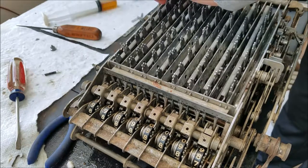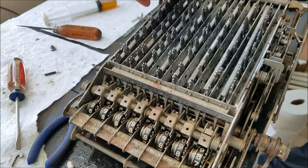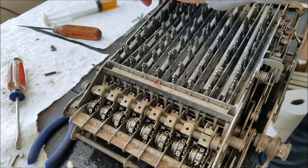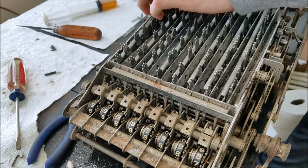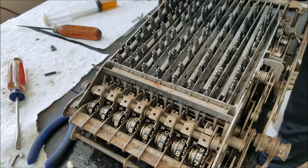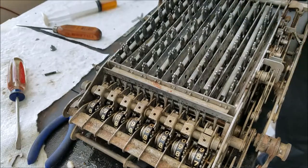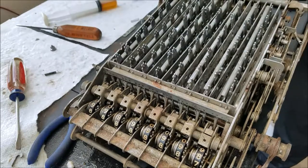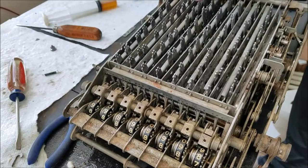I want to lift up and put it in the right hole. I'm going to go with the lower hole. The reason for that is there's a hole on this piece of the frame where you can stick the rod through and more or less line it up with the holes in the plates. So I can stick the rod in and fish it through, then get down here and fish a spring onto it.